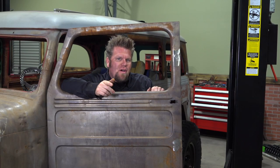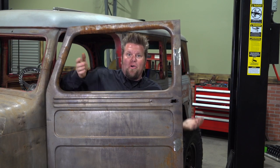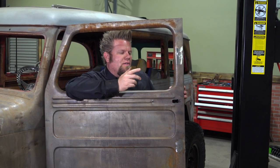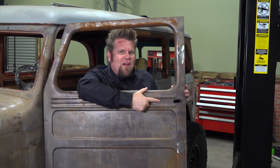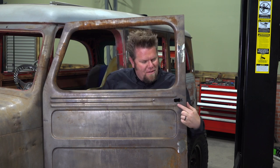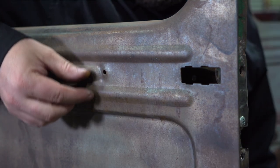This next sheet metal modification isn't something you see done very often on off-road rigs, but it's pretty common in the hot rod world. I'm trying to basically glue a hot rod together with a rock crawler. The factory door handles on the wagon just aren't jiving with my bear claw latches. I have a couple options — find a different handle or come up with some mechanism inside — but instead I'm going to shave the door handles. Even just a month ago, I would have thought the easiest way was to fill this little hole and the bolt hole and continue the body spear down.